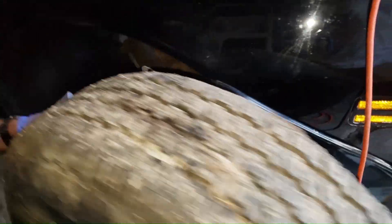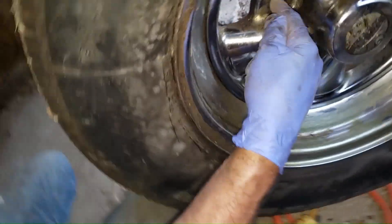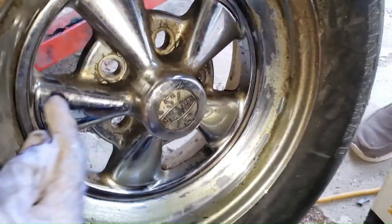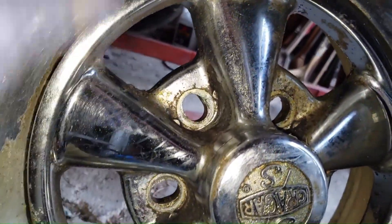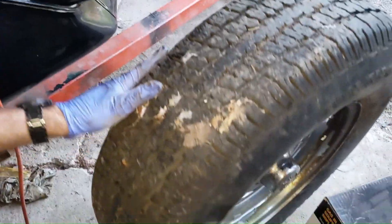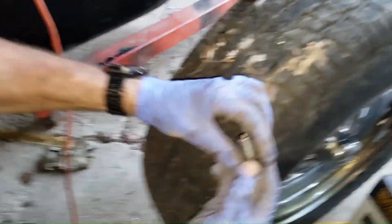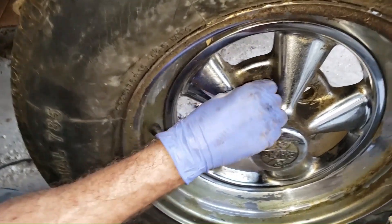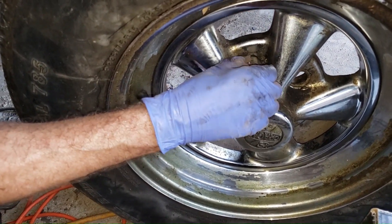Well, these are what they call a unilug rim. If you look at that, where the hole goes in, it's an oval — not a round circle, it's an oval. It's designed so it can fit on several different bolt patterns. And the rims are about that thick, so they're designed with that deep shank to go into the rim. There's a washer that goes on too, and they go in like that so that they hold the rim so it doesn't move around.